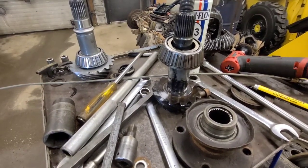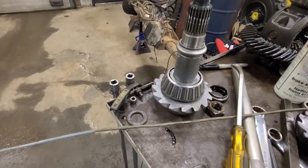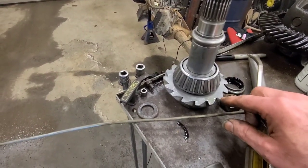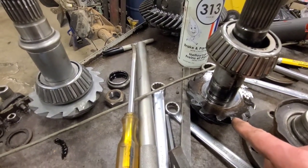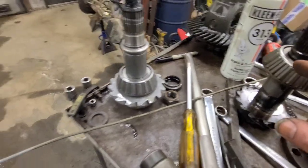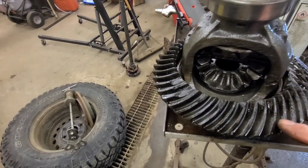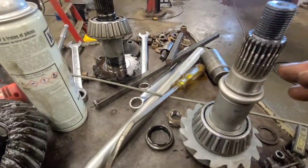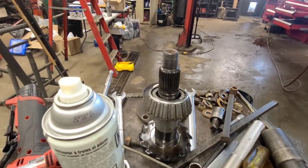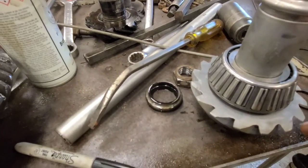I am not impressed. I'm putting the pinion in and I noticed it looks a little different. There are 16 teeth on this pinion — there are 14 teeth on this pinion. So somebody's changed the carrier in here, because this carrier has the markings on it 4716, but that's 4714. And the spline is different on the output shaft — this one's finer, it's got 29 splines, this one's got 24 splines. But nevertheless, I've got the wrong gear ratio now.